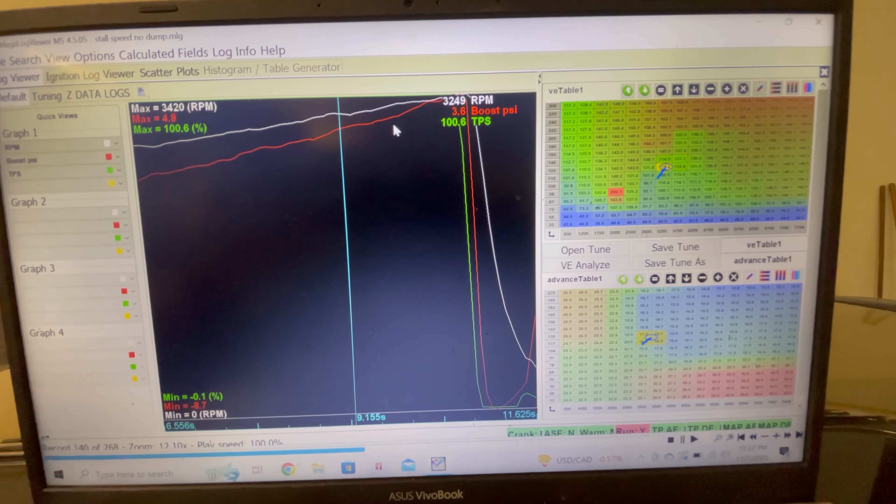I'm really excited about the dump valve results. Went over the whole car — nut and bolt, inspected every single fastener. The car's in good shape. The oil leak is driving me nuts — we have to get through this weekend and then I'm fixing it. I really think it's just a poor choice of RTV type, because all the leakage seems to be coming from around the upper oil pan gasket, mostly in the rear. Just the whole time I was running the engine I only got a couple drops on the ground, so I'm feeling okay about it. Fire extinguishers are installed too.